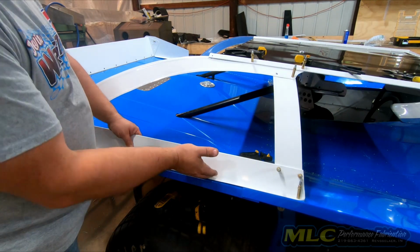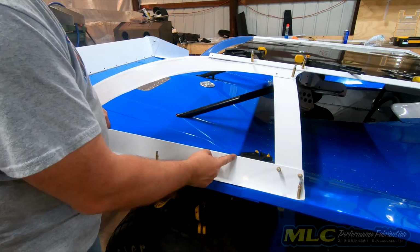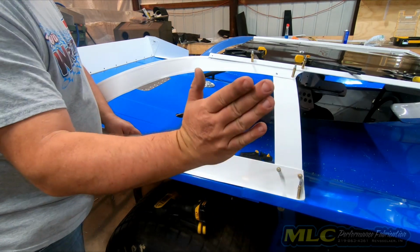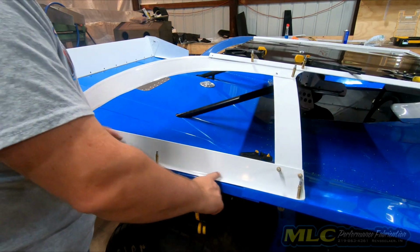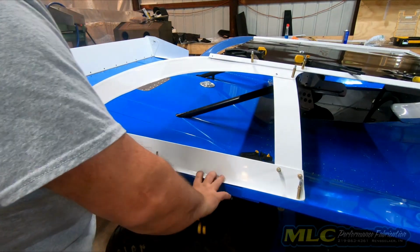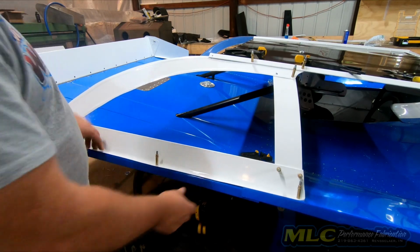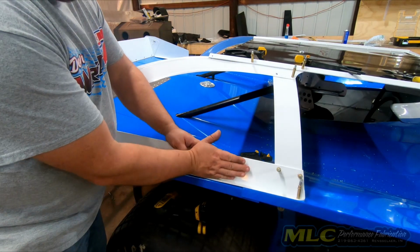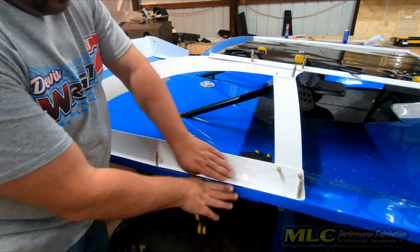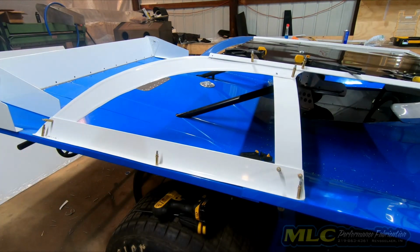Instead of this panel being hemmed up, you put a hem on the top. It still maintains the 3 inches tall, and then you put just a regular break on this edge. So when you put the door on this side, the door will overlap this to sit on here. Then this will be between the door and the deck. Unlike that side, where I bring this down, when you put the door on, this panel here is flush with your door panel. Just this side, I just indent it.